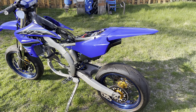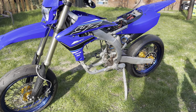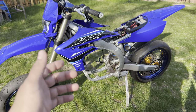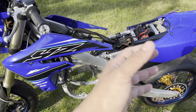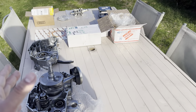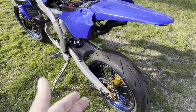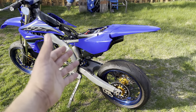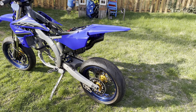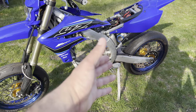I have put — I want to say — 24 to 25 pounds of boost through this thing. Towards the end of the season I was just saying 'what the hell' and throwing everything at it. I did bump my head quite a bit to get the tune where it landed. It was definitely a learning curve. The 105 horsepower this thing made on the dyno was actually at a lower boost — about 15 to 16 pounds — and it put down 105 horsepower to the rear tire.